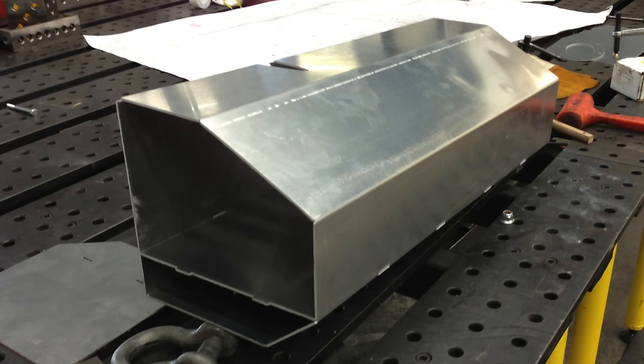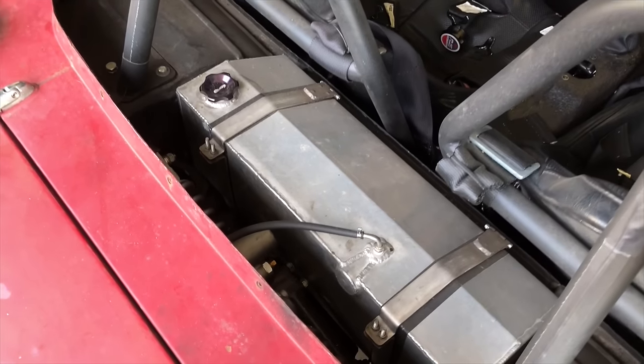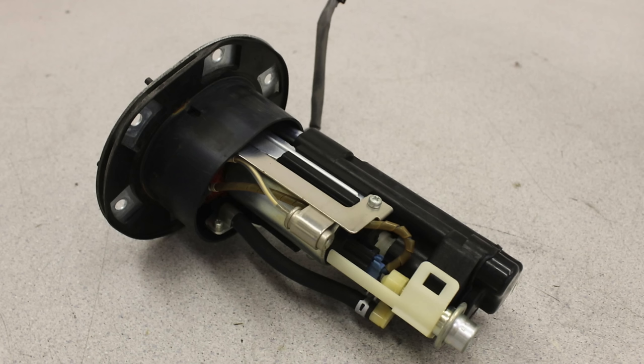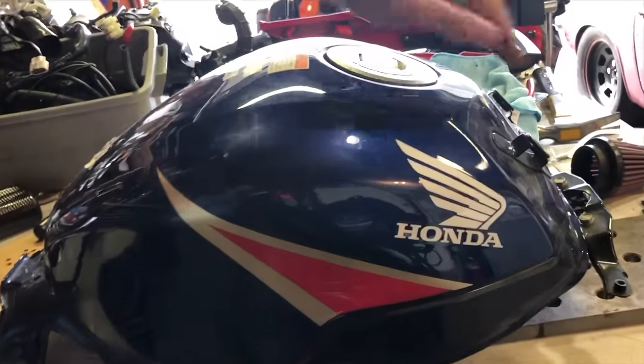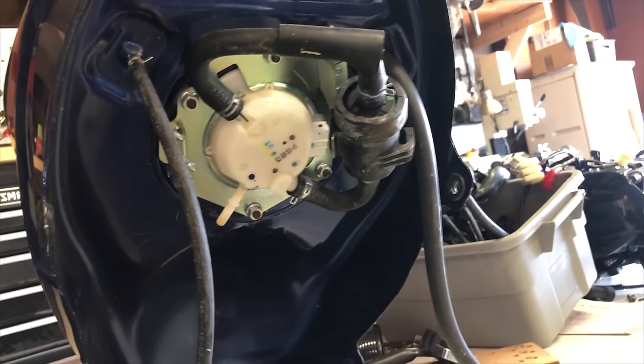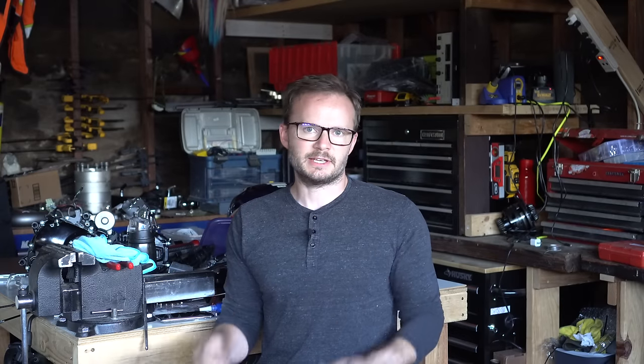I chose a more complicated path and built a whole new fuel tank. The fuel tank in the car was old and rusted, and I also wanted to use the whole fuel pump assembly from the motorcycle. Most modern motorcycles — if you take the fuel tank off and look at the bottom — you can pull out a whole assembly by removing six bolts. That's the filter, the regulator, the pump, and the level sender. I just took that whole thing and put it into a new fuel tank. I recommend doing this or adapting it to the existing fuel tank — either way it's pretty easy. It's already got the fuel flow, pressure, sender, and regulator you need.